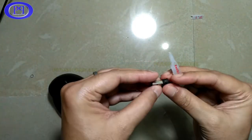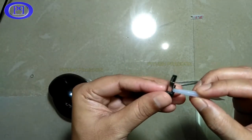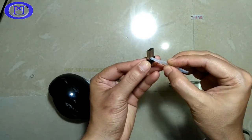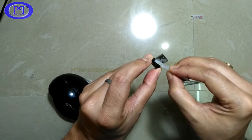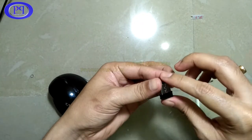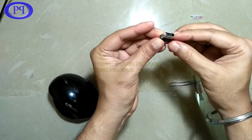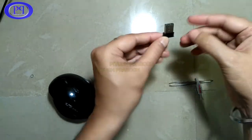Now it's time to fix the adapter — you need to be careful here. Hold it correctly while applying adhesive, because if you hold it upside down the glue may isolate the pins and the connectivity to the USB port will not be proper. Keep the metallic part facing upward until the glue dries, and apply only a small amount — this quick adhesive won't take long.